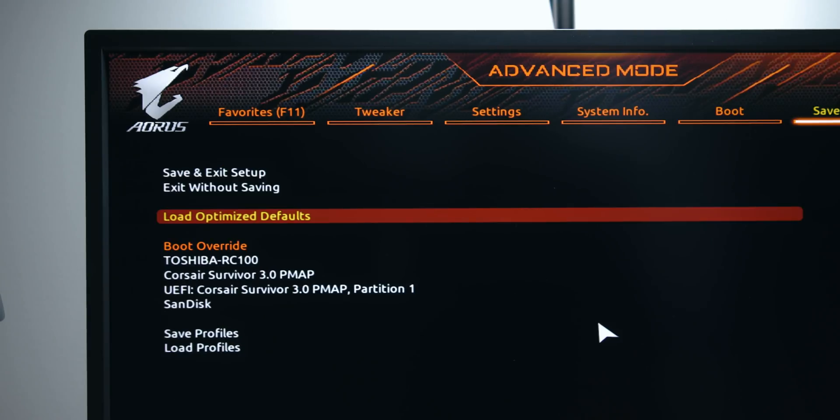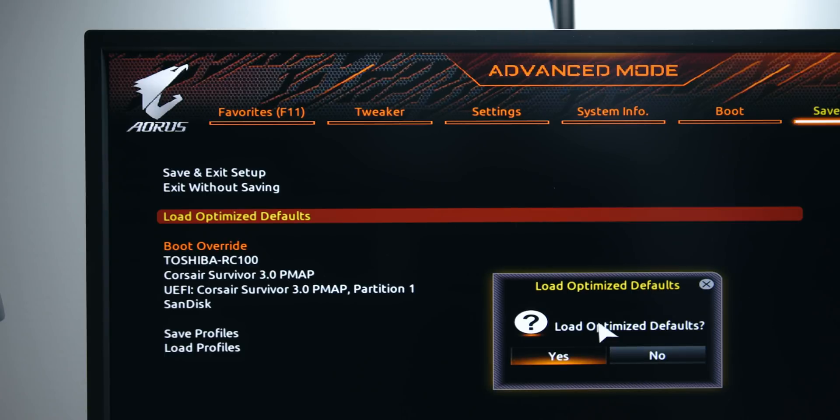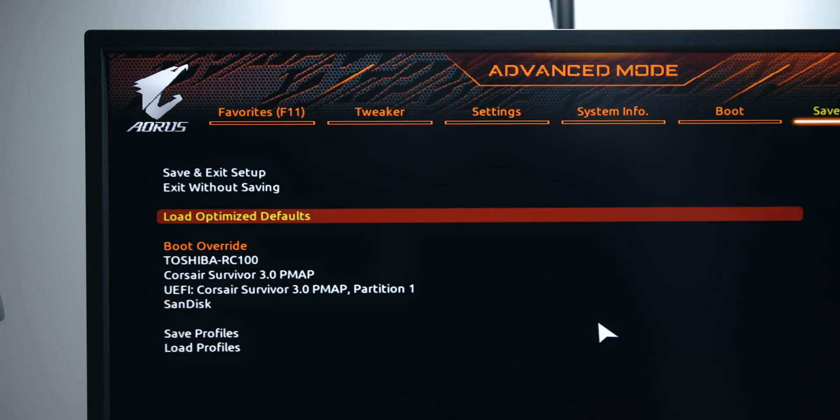If you still don't see those proper core ratios and your CPU temperatures aren't around 90°C, that clearly means your CPU is not boosting properly. To fix this: if you're already on the latest BIOS, try clearing the CMOS or loading optimized defaults within the BIOS. If none of that works, you'll have to wait until the motherboard manufacturer releases a BIOS that addresses the problem. Unless you're overclocking, don't mess with any frequency, multiplier, voltage, or power settings in the BIOS, as fiddling with those settings can stop the processor from boosting properly.